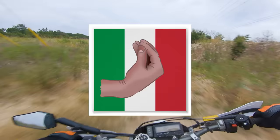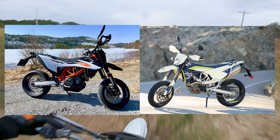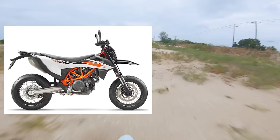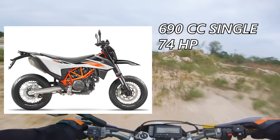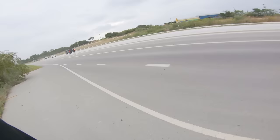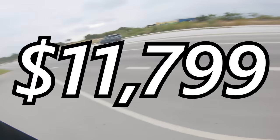I know that aspiring fast boys who are tall and don't fit on a little 300 or 400cc sport bike aren't going to want to hear this, but the DRZ400SM is actually a great place to start — 35-inch seat height and really comfy, roomy ergonomics. But if you want a sumo with a little more panache, a little je ne sais quoi, the other factory option is the KTM slash Husqvarna 690 platform. They're basically the same motorcycle, so pick whichever looks nicest to you. The KTM LC4 engine makes 74 horsepower and 54 foot-pounds of torque from its 690cc single, weighs in at 360 pounds, and features a six-axis IMU, lean-sensitive ABS, traction control, wheelie control, rider modes, and a bi-directional quickshifter. It's priced at $11,799 brand new.